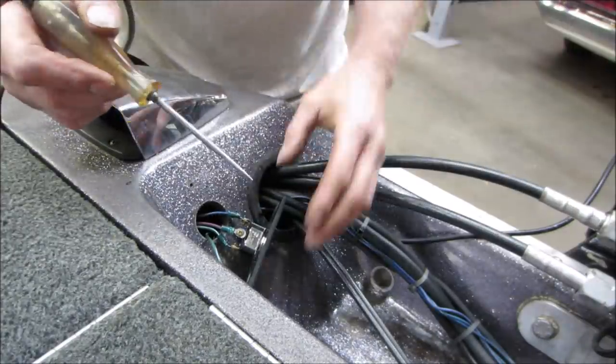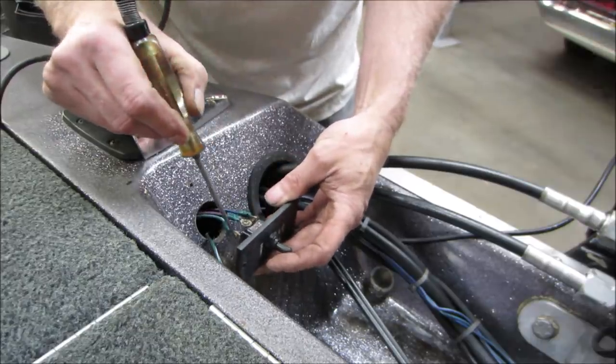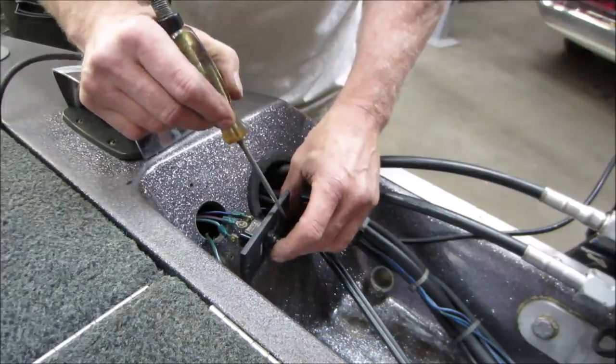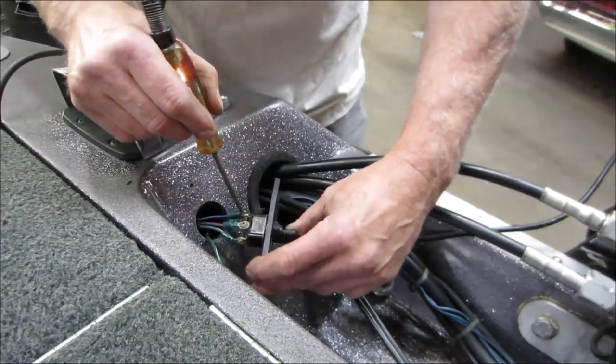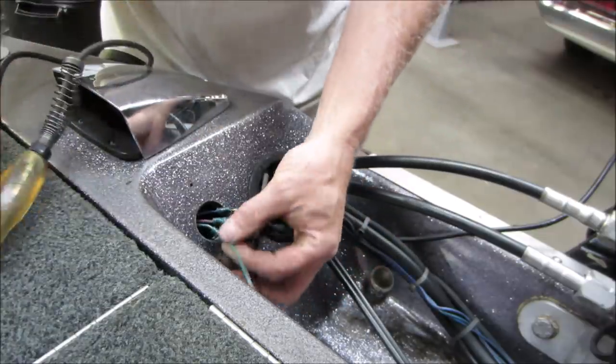So the other end of the test light is grounded out. So that's power coming in the middle. And then one way should be up, one way should be down. So probably the switch, this, that probably powers this side. Yeah, and then down. So power is going out of the switch. The switch is working.